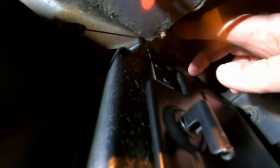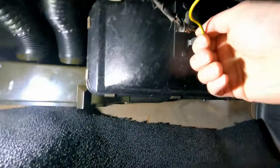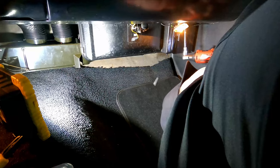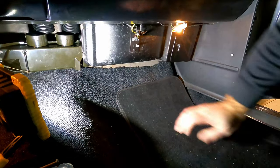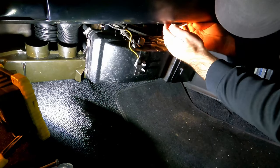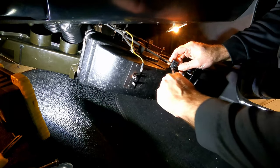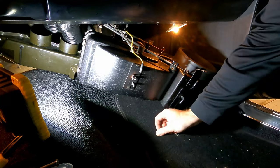Inside the car there's a screw right up there — we'll take that screw out and then this thing should drop down. Then we'll just have to disconnect the cables once this drops down. Now let's go ahead and take these clamps off that hold the cables in place — they just slide off. We don't want to lose these little fasteners and clips because we're going to need those when we put it all back together.